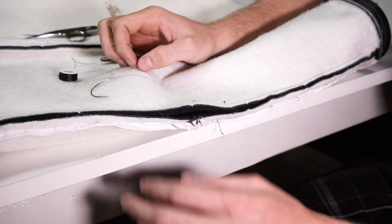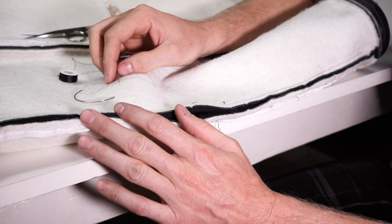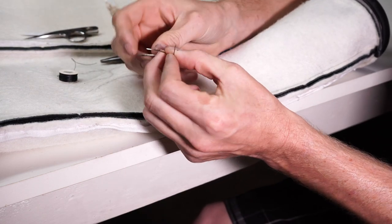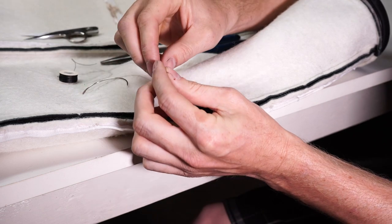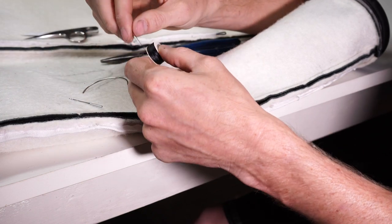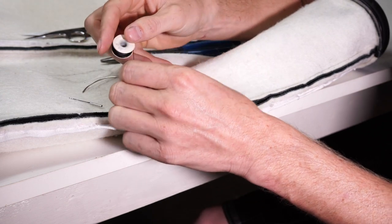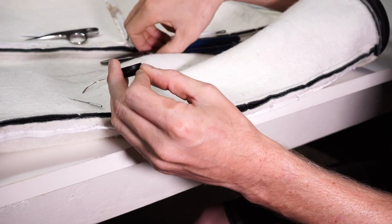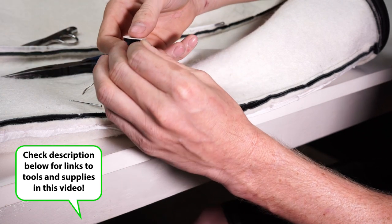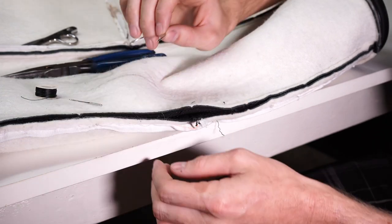For those of you out there that don't have a sewing machine, I'm going to show you how to fix these ripped seams by hand. It's a little bit more work, but you can actually do this at home with just some basic supplies. What you're going to need is a nice curved needle like this one, and a sewing machine needle — this is a size 17. You're going to need some thread; make sure it matches the color of the seat you're sewing up. This is size 92 bonded polyester. You'll also need a pair of needle nose pliers and some scissors. If you don't have any of these supplies, I'm going to put a link in the description below with all the information and where you can buy them.